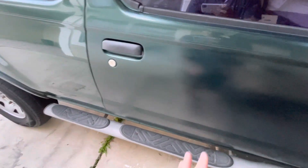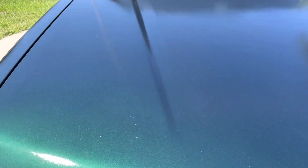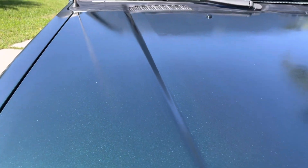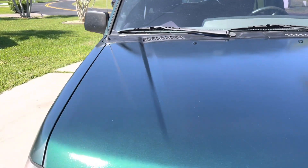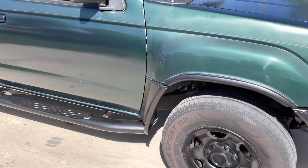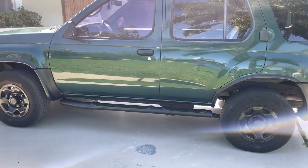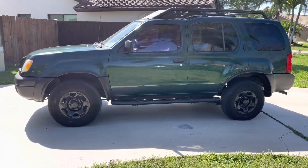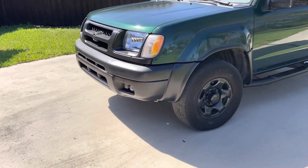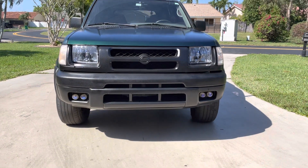You can see the door here — it's just not as glossy. Here's how the paint came out. You need that third coat of clear to get it glossy and get rid of the overspray streaks. The car's dirty — I haven't washed it. You'll notice I also painted the bumpers black. Check out my other video on the Xterra makeover if you want to learn about how I painted the bumpers. I also changed the headlights out — I talk about that in the video as well, to update an early 2000 Frontier or Xterra.